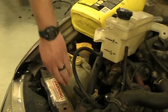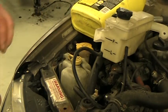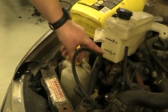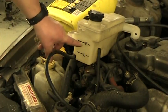It's really hard to see the markings because they're down on the side of it, so I've taken one out of another car. When the car is cold, the coolant contracts — it shrinks up a little bit — and the coolant should be at the lower level. Once the car gets hot, the fluid expands and it should rise up to the full level.